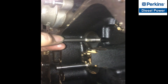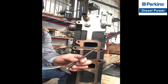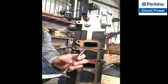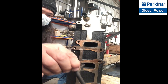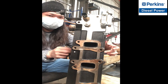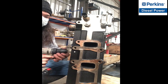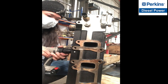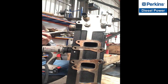I'm going to start grinding the six valves using a grinding coarse compound and put some oil on the valves to make sure that the valves and valve seats are perfectly fitted. I'm using a portable hand drill in order to make the work faster and easier.